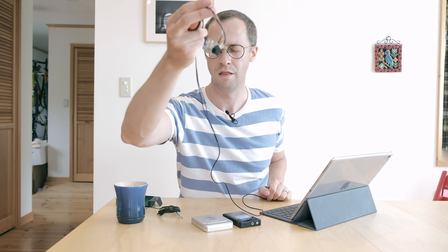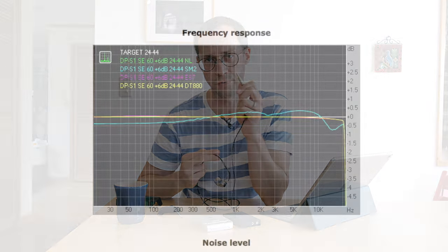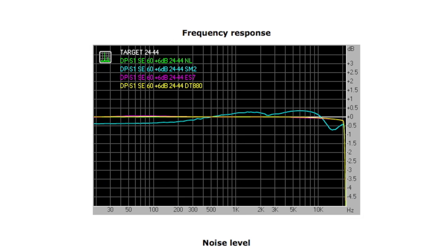So there's not a player on the market that's going to hiss less than this one. You can use expensive and super sensitive earphones, like these Fit Ear custom earphones which cost like two grand almost, perfectly well with this player. The only proviso is that when you plug them into the headphone output, there is a little bit of load effect, so you will get a slight dropout in bass and a slight uptick in treble — maybe a little peak around four to six kilohertz. But it's not audible, it's probably around a decibel or two.